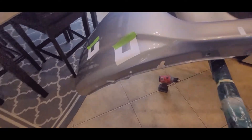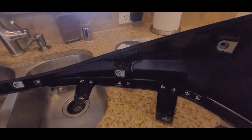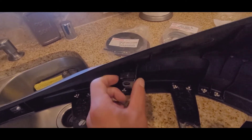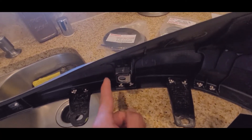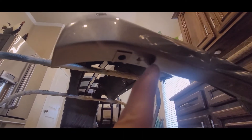What I ended up doing was making some U-shaped paper labels that you can stick on here from these — it's a 30 by 30 millimeter square. I made a U-shape of the 30 by 30 and then mounted the spoiler on temporarily. But the first thing you have to do is drill your holes underneath. From this divot here to here, that's about 15 millimeters. So you want to drill 15 millimeters from the center of this hole up to the top.